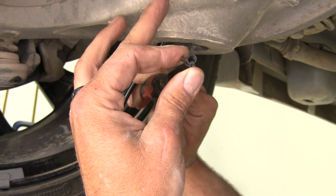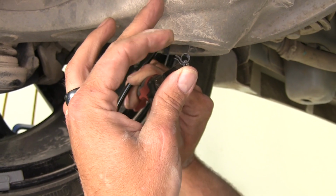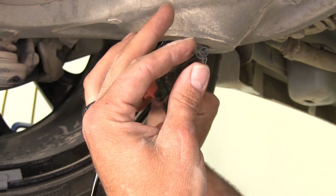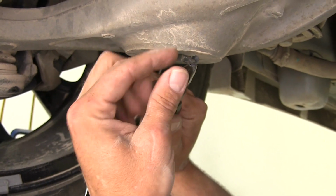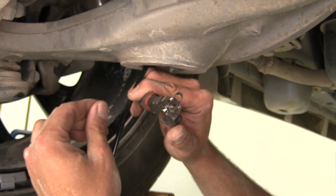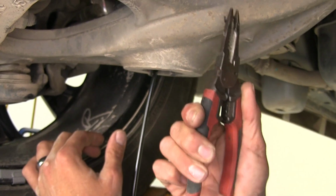Now we've got our uni clamps that we need to slide up on our hose and over the barbed fitting. This is just going to give us extra protection and keep that airline from sliding off. We've got 2 tabs on one side, 1 on the other. Basically, you'll just squeeze those and you'll see how that's going to expand. So we'll slide that up and on.